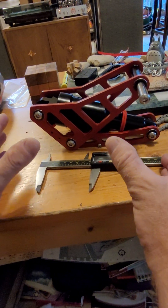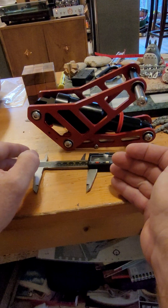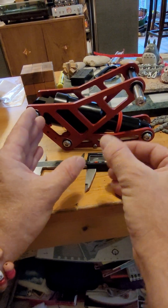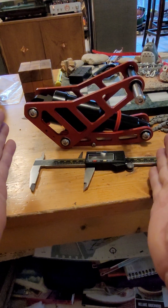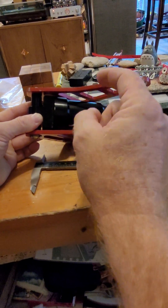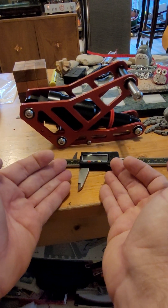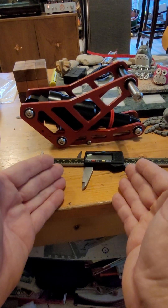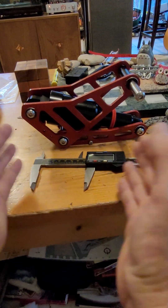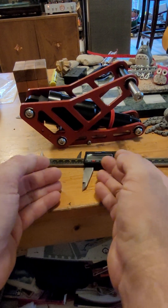What does a 3.3 ratio mean? It means that as a 220-pound rider, fully geared up, I would probably need approximately a 2,400 pounds-per-inch spring ratio — and I don't know if I can even buy one that high. This is why everybody with Master suspension has to go buy a custom aftermarket shock pump that can go up to 600 psi, because the shock has to be grossly overinflated in order to generate enough spring force to support any adult rider with a western frame.